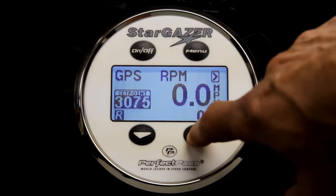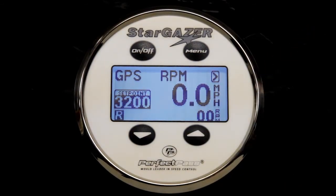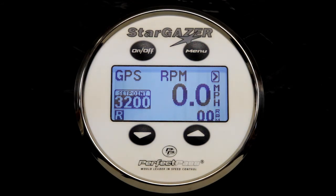3200 RPM is a pretty good RPM that matches slalom speeds. Now we're ready to do a pass in the open water. You're going to throttle up reasonably aggressively, just like you would if you had a skier in tow. The system will beep to engage and the digital tach will climb, match, and hopefully lock on and hold tightly at about 3200 RPM. We'll throttle up the boat and the system will beep to engage as it approaches the set point.